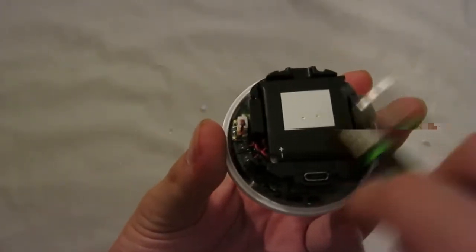So we have the circuit board. Let's see the front side of the board first. On the front side we have a wireless chip container of some kind, probably for the Wi-Fi and BLE functions, and these are the antennas for it. We also have the lens and the image sensor underneath. We also have a Winbond chip, which probably contains the firmware and nothing else, and this is the micro SD card connector and the micro USB charging port connector.